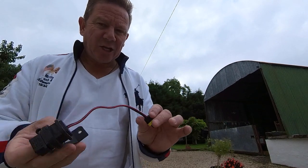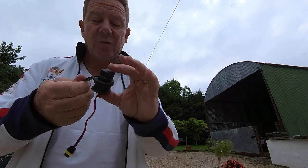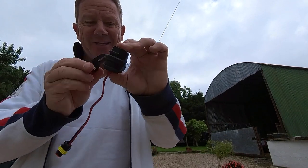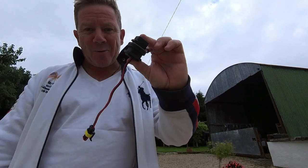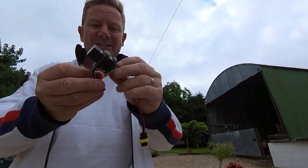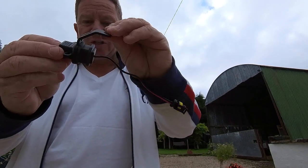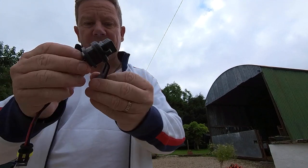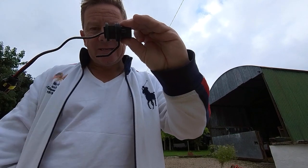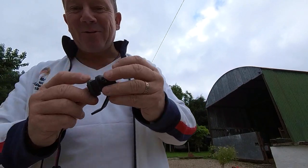You haven't just seen this huge behind the scenes operation because it's just taken me ages to figure this out and I couldn't find it anywhere online. So this is the only way this bracket will work — trust me. The key to it and the secret to it is to put the rubber grommet in first, otherwise you'll be there for hours like I have just been trying to sort this out. I can just show you a few different angles of how it should sit — it has to sit that way around with the screw hole there, and put the rubber grommet in first. Otherwise you'll be on for hours. Right, now I'm going to fit it.